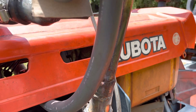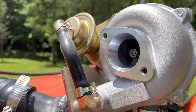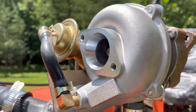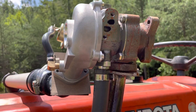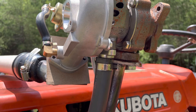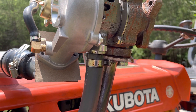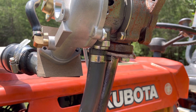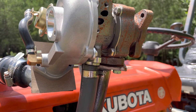The RHV31 — nothing special. We don't even have an air filter on it because we ran it for like, probably 10 minutes of runtime total. But it is interesting. You can tell a difference, surprisingly. Even at 3 PSI, before on that hill in tall grass it would kind of bog down. It definitely does not bog down now. It would basically bog and start puffing a little bit of black smoke, and you'd hear the RPMs drop. With a turbocharger on it, it doesn't.